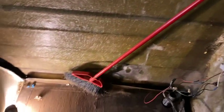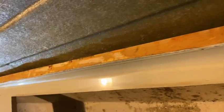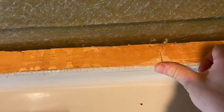Got all of the fiberglass exposed and all the foam pushed out. I'll have to figure out a way to get that anchored into the ceiling with some sort of adhesive. I'll probably put a stringer up in there as well to close that gap a little bit - I want it a little tighter up there so there's no sag. Put a little stringer in there, get some adhesive, stick it to the ceiling, and hopefully that'll tighten it up.